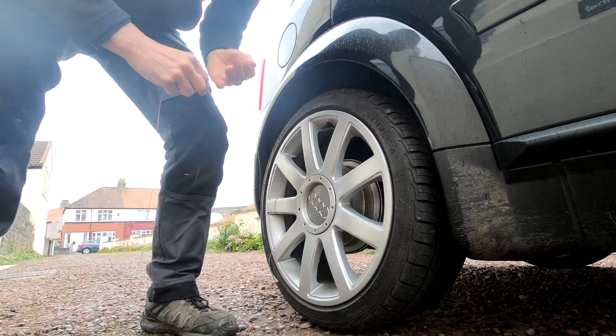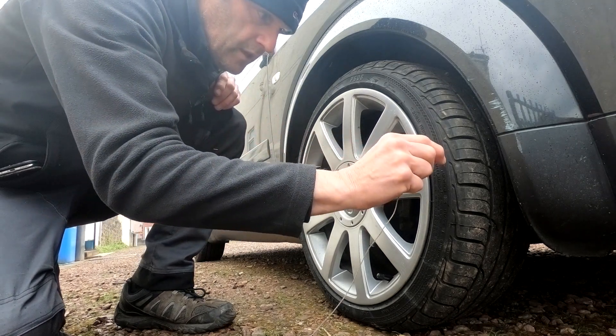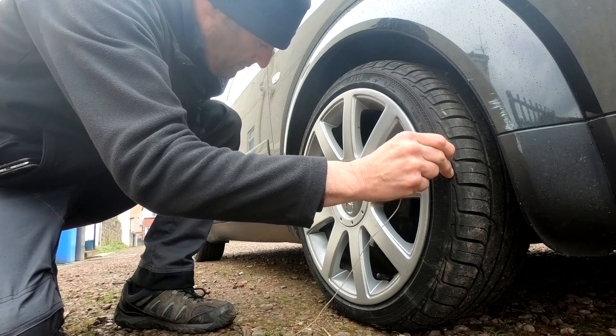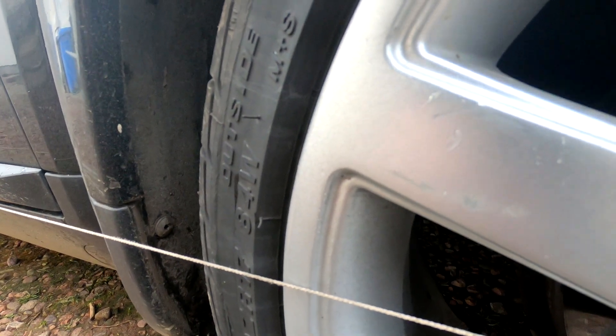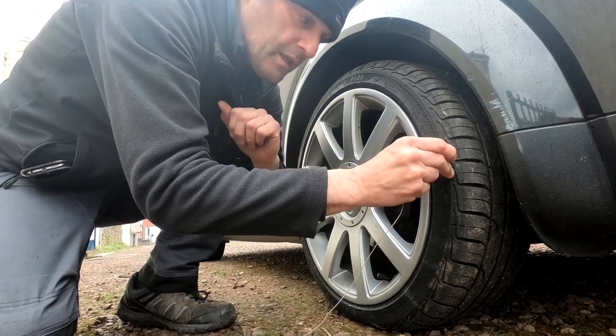All that I do is bring it towards the front wheel like that and you just touch the back of it on the tyre at the back. And as I suspected it's toed in, and it's toed in about five millimetres.